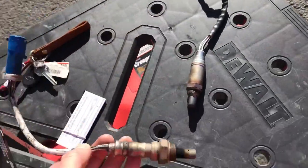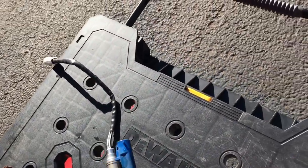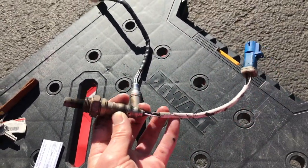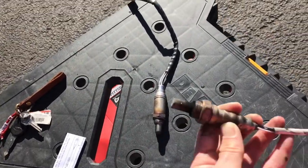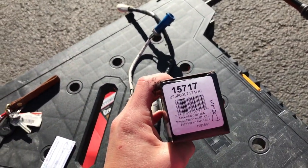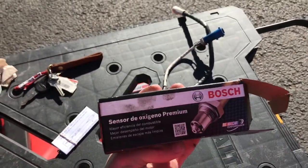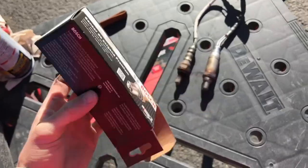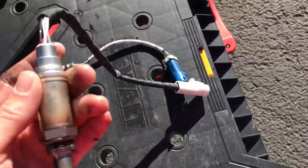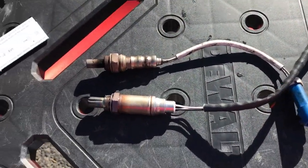So I got this downstream oxygen sensor out and this looks like a really new plug. So I'm afraid this maybe was one of the ones that has been replaced already. I may hook it up to my multimeter later, but I've got the part so I'll just replace it. This is a Bosch 15717 downstream oxygen sensor from AutoZone - that was like 48 bucks or something. Looks a little bit different but it says it's the right part number, so we'll hook her up and see if she screws in.